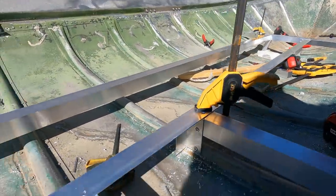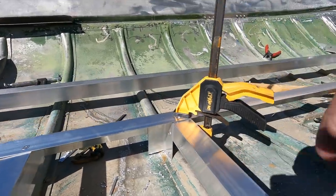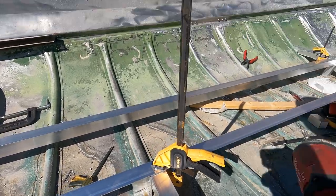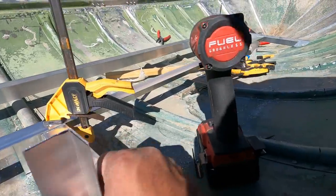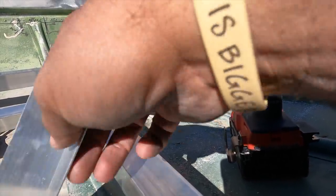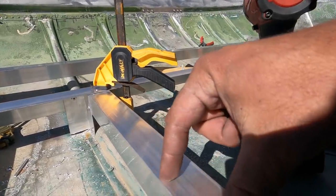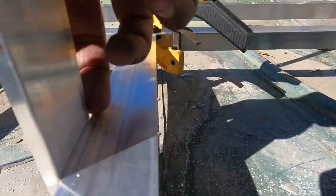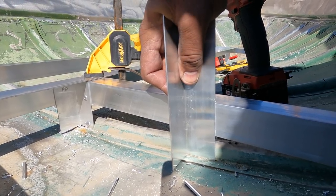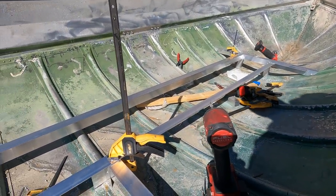This one I'm going to redo — flip it so the rib is closer this way. That's a pretty strong joint right there by itself. We're going to attach the countersink to the top and that's a really very strong joint. If you wanted to run more because you weren't happy with the joint, you could. That will actually stiffen the whole bracket because after about a foot it starts to flex — you can feel it. About 10 inches to a foot, if there's no gap, it stays pretty stiff. You can trace one, cut it, rivet it, and just do that for a lot of brackets. The more brackets you have for the subfloor crossing and the actual beams, the substantially better off you are.